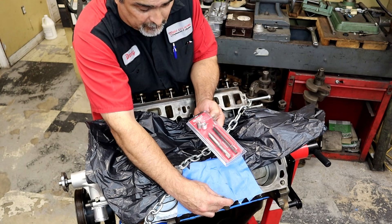I'm going to give you the tips that aren't on the back of the package. The first thing: cover the area up, tape everything up, because you will be using air to blow out those threads and you don't want to get metal in there. Use a lot of tape. The next very important part is to use the proper drill. The kit tells you the insert part number so when you're done with these inserts you can buy another pack of eight.